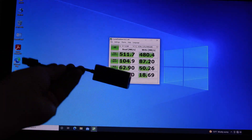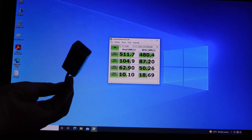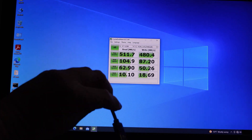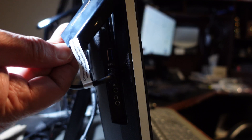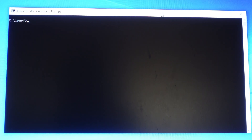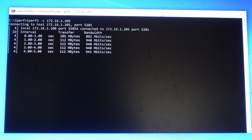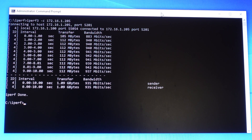What I'm going to do now is use this network adapter that uses USB 3.0 to convert to a 1-gigabit network. Because, as you may recall from the previous test, the network speed was only 100 megabits at best. So I'll put this on and connect the network cable to it. I have iPerf 3 loaded here. Let me run it — it's going to use my server. Wow, look at that: 940 megabits per second, 942 actually in a couple of cases. That's extremely good.